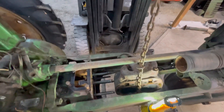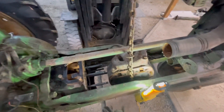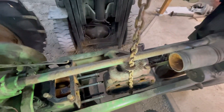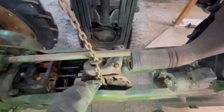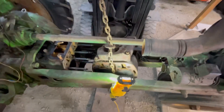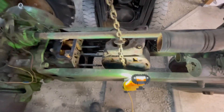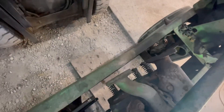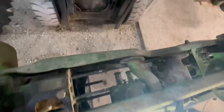It took a little bit of hassle but I got that head gasket out there. Had to keep smacking on it and prying it — like I say, it was getting hung up on the threads on those stud bolts, so I got it worked off. I was actually able to get the gasket out from behind that chain. I've got the head turned and I wasn't sure how well it was going to fit down through that frame, but I think I've got enough room so let's see what happens.